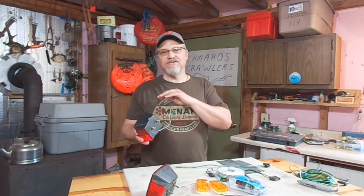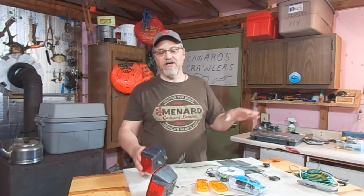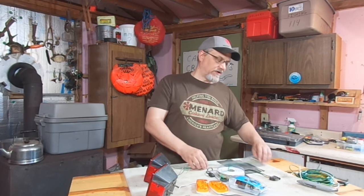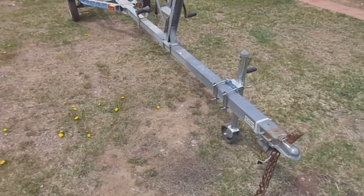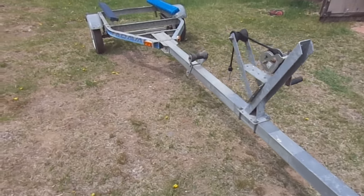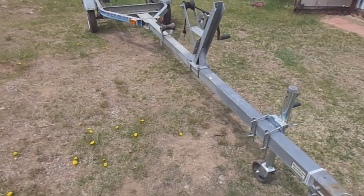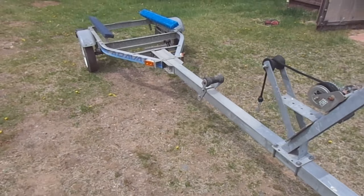Now, a fixture like this one does have a white wire, and it comes right from the factory with a little ring on it. Often this ring will either go right on the stud as you mount it to the frame of the trailer, or you could drill a screw into the frame of the trailer and ground it that way. But this white wire is the return path for the other circuits in this fixture. Either way, the return path back actually utilizes the frame of the trailer. So you have to have good electrical continuity from each fixture to the frame of the trailer, and then from that area all the way back up until the frame meets up with this white wire that will be grounded and electrically connected. So basically, the trailer frame is used as a white wire.